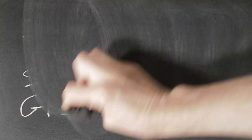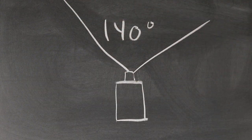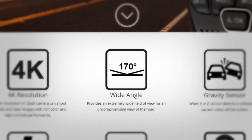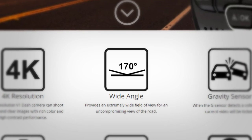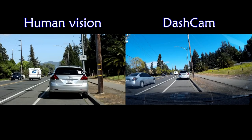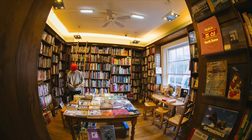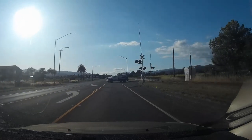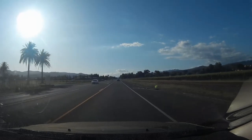One thing that really stands out to me is the fact that this dash cam has a 140 degree field of view. Most dash cams that I know of have 160 up to a 180 degree field of view. More is not always better. A larger field of view does capture more action off to the sides, but this comes at a cost. The larger the field of view, the more of a fisheye effect there is, which makes objects in front of the camera appear further away, and also exaggerates the apparent speed of the dash camera.